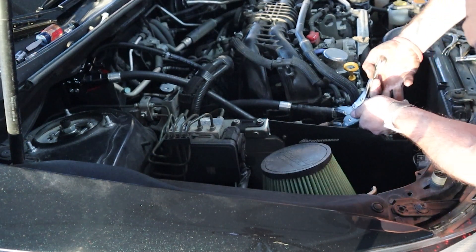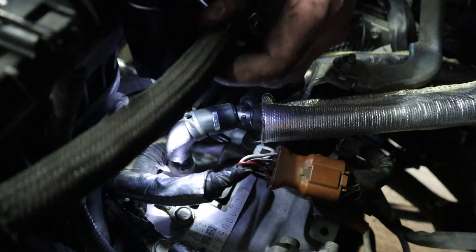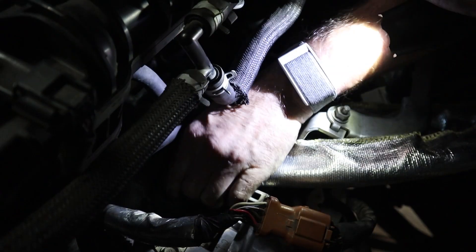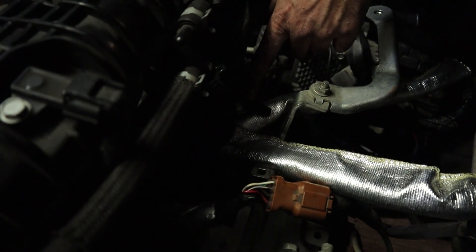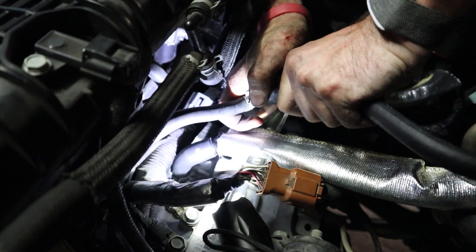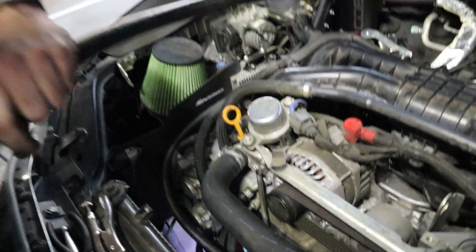Against our better judgment we're gonna let go of that. Down there - these are vice grips because we're smart - to hold the spring clamp so it doesn't pop off and smack me again. Boom, we've got our spring clamp on our 90. We're gonna plug it into our PCV hose right there. I already like the design of the COB over the IAG because even in their instructions they don't have it fitted through this hole right here. Now we're on there. We're gonna get this hose clamp off, pull this line off - these are the top two breather hoses - that's gonna go right there.